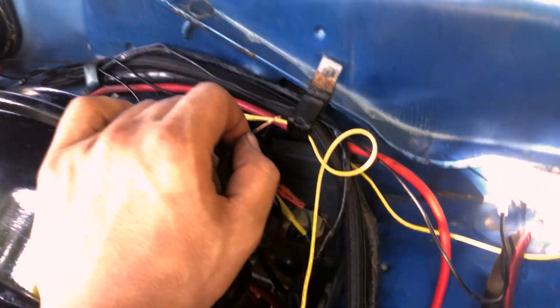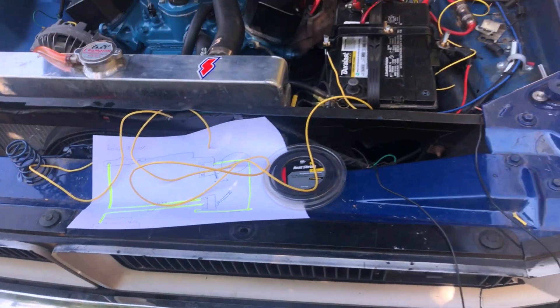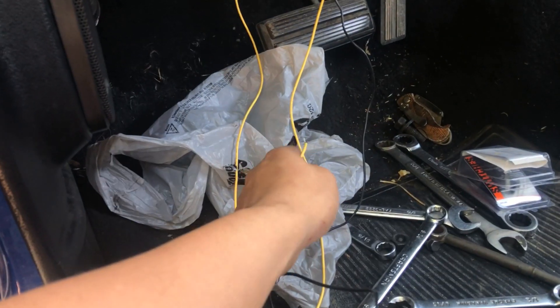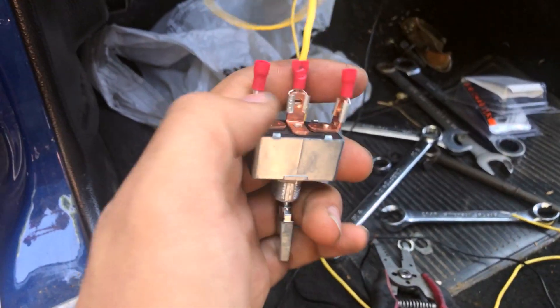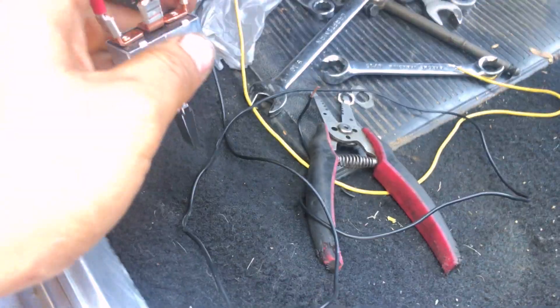After we've got all the wires going inside, the next step is to install the ground wire. I've already put a quick disconnect on this — I'm just gonna plug it into the lower end right there. Once it's connected I'll go ahead and ground it right here. We've got those three things complete — let's check our diagram. We've got all wires going to our switch, so let's go ahead and wire up our switch. Make sure you know which wire is which — this one's my 12-volt wire so it goes straight to the middle of the switch. The other two are low speed and high speed; it doesn't really matter which side ends up on which. Then I'll go ahead and mount it into its spot.